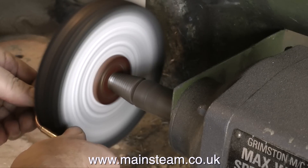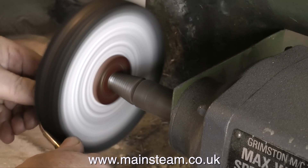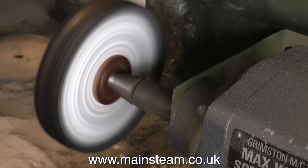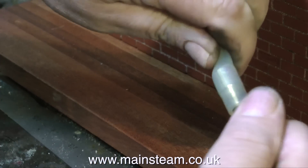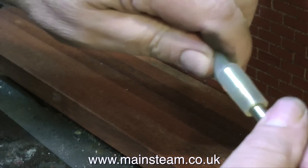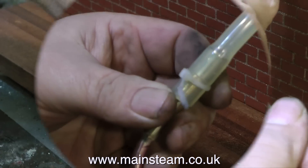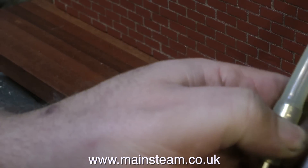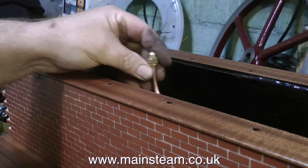These pipes are inside the engine and never seen by anyone, but that's not the point — I still clean them up to get rid of the oxide. I didn't bother putting these in my acid pickle bath; I went straight to the polishing spindle. After which, I fitted the silicon rubber piping to them, and then in exactly the same way as in the previous episode, I used a couple of cable ties around the silicon tubing to keep it in place.